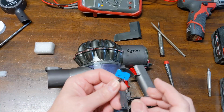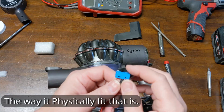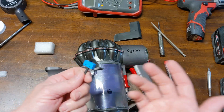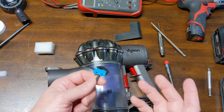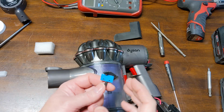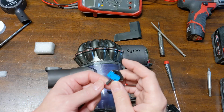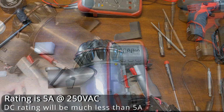So even though I like the way this push button worked out tremendously well, I realize in low we're pulling about 5 or 6 amps. We switch to high, we're pulling up to 3 times that much and always more than twice that much. So we run anywhere from around 14, 15 up to 18 amps when we switch over to high. So this switch is absolutely not going to hold up.